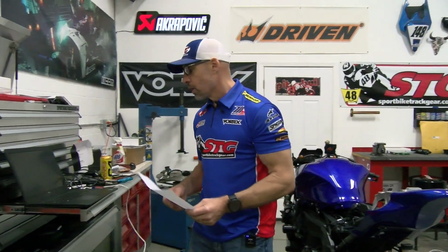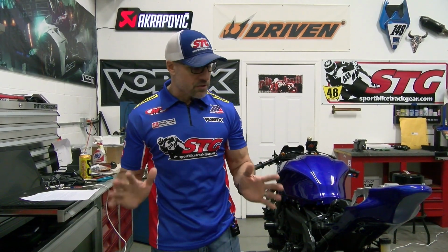So initially, the most common issue is when you get a no response error like we got, right? It's going to end up being misinstallation of the harness. I was a mechanic at a Cadillac dealer for a long period of time before I started this. I've rebuilt a lot of connectors. I'm pretty good with that stuff. It doesn't mean I couldn't make a mistake. So I did go in there and I double and triple checked, made sure the pin locations were right, that they were all fully seated, so on and so forth. The installation of the hardware was very good.